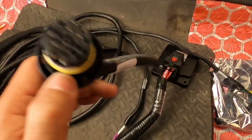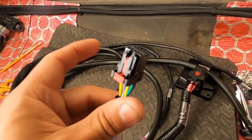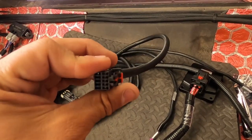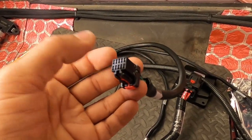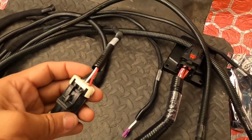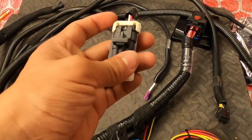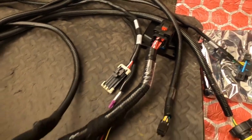On the transmission side you've got one connector, that's it. This one here is for your shifter. You've got to run the stock 2016/2017 Charger shifter — that's the only way it'll work. You're going to have to locate a stock shifter if you don't have one. This one here is just a laptop calibration tool to get into it and mess with the settings. I'll probably route that in the same area as the OBD2 port.